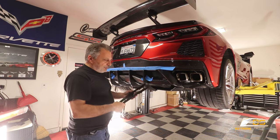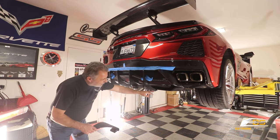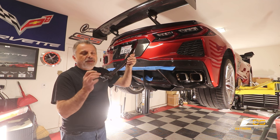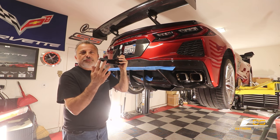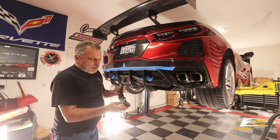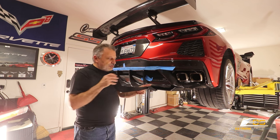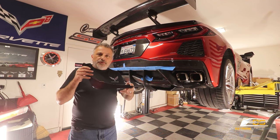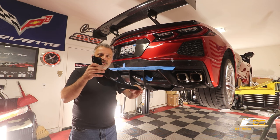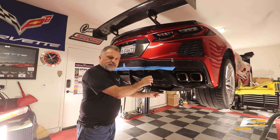Right here at the bottom is the mounting point. Two screws go to the bottom of the trim at the bottom of the bumper. The fins go onto the car and butt up against the bottom of the bumper. What you're doing is sliding this around to find the happy spot where it fits, then making yourself a little template so you can mount it.